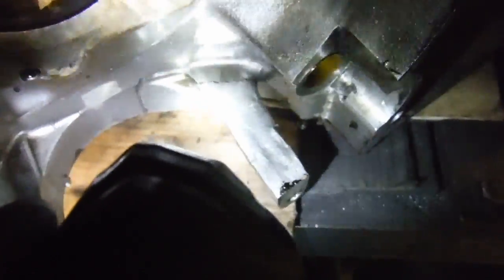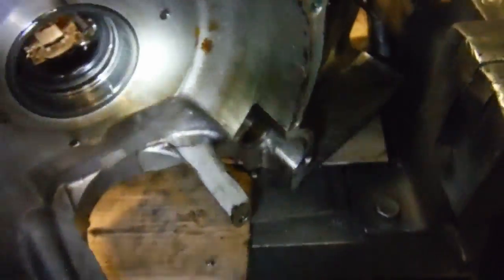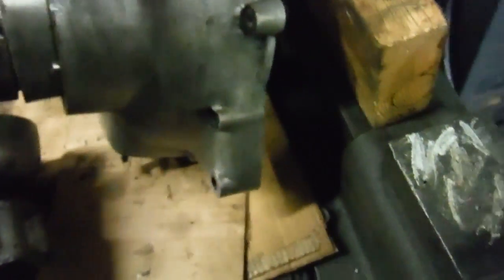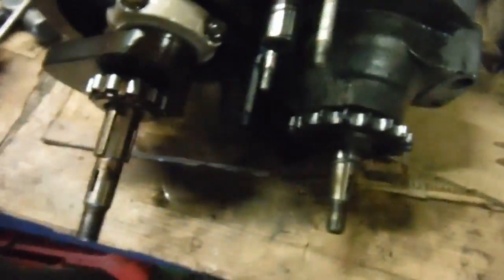I'm sure one good whack with the hammer and that would come off, but as it's holding I think we can get that V'd out and welded up, and that will be okay. I'll just have to helicoil the damaged stud hole in the crankcase mouth, and then I think the crankcases should be good to go again.